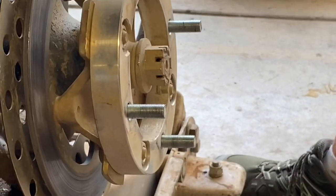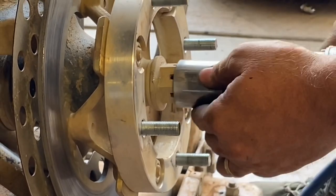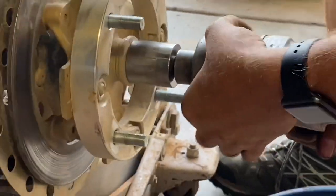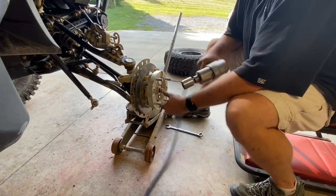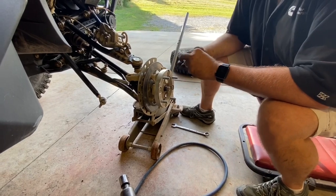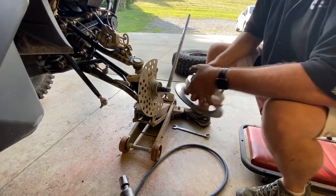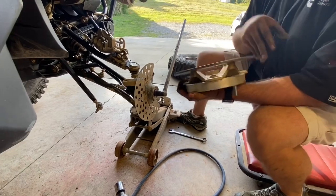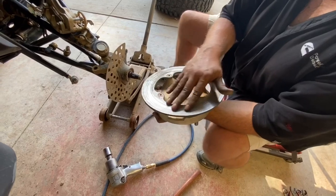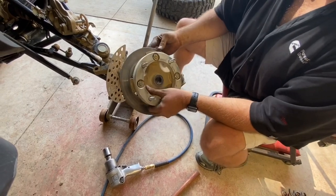Next, we want to pull the nut off the axle shaft — it's a 32mm. Normally I'd use an impact socket for this, but I didn't have one today, so I'm just using a chrome socket. They are on here pretty tight. Once you have that loose, the axle will be free, the spindle will be free, and the hub too. Take a look at all your parts. I don't know if it'll show up on camera, but this rotor is pretty well chewed up — it's had a lot of dirt and dust, and there's been metal to metal contact with the pads for some time.